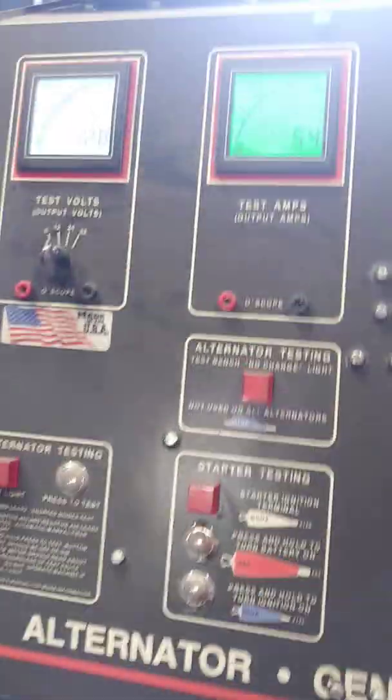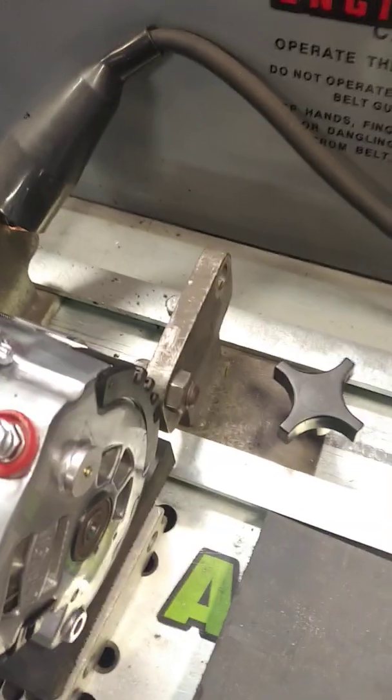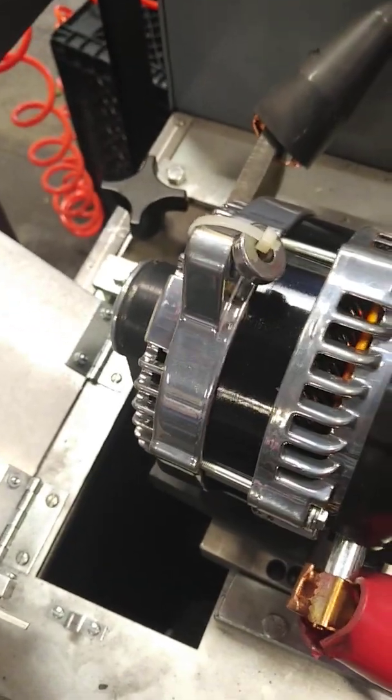Now what we want to do is show you a side-by-side against our alternator. We won't pause the video — we're just going to put the recorder down and do an alternator swap on the test machine. Give me about 30 seconds. So our Denso hairpin, dual internal fans, billet case — we designed this custom ourselves for guys using the serpentine systems. We use an internally regulated ignition source turn-on, as opposed to the one-wire setup that most slot-wound styles offer.